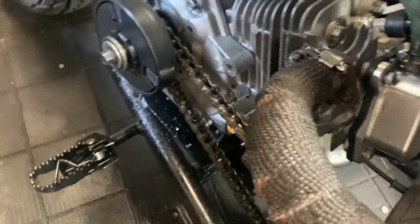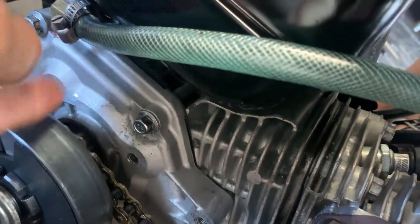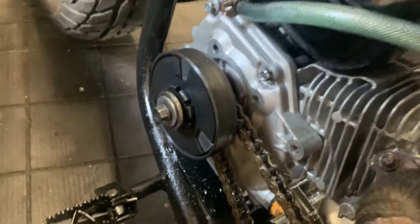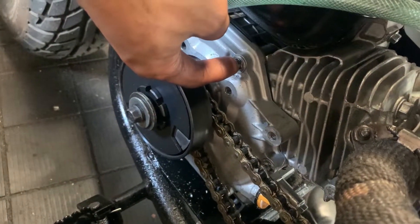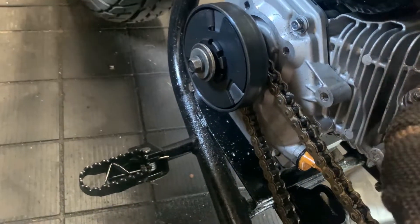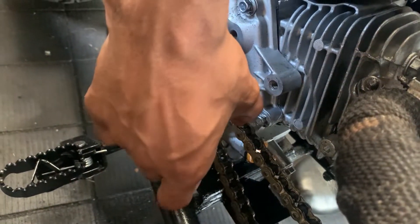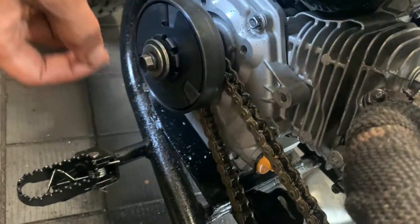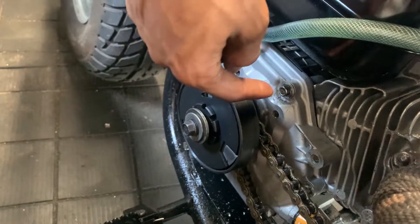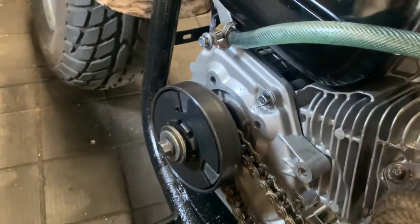It's on a clutch right now — a clutch that's kind of a piece of junk. Don't mind all this oil; I had a little incident. I want y'all to be vigilant on the 224. Mine had a few problems where the bolt had thread inserts — helicoils — that came right out. Literally, the helicoils came right out. I might have to re-tap this one right here on the side cover because that one's been spinning out. I might have to re-tap this top one too. I already had to redo this one and let it seat and set yesterday. My drill died on me so I didn't get a chance to do the other ones.